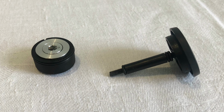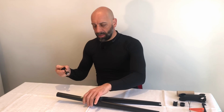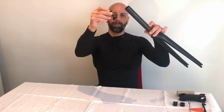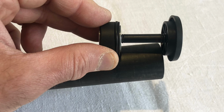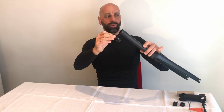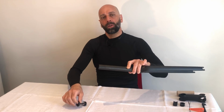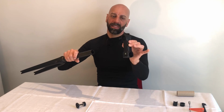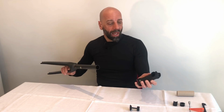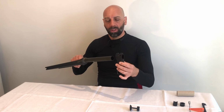So this is the usual setup. This is your top cap. This plug is usually around 3 centimeters inside the fork, and when you position the stem with loose bolts, you will be able to pull up the fork to compress the bearings, and then you will tighten the stem clamp. Very, very simple. I've been riding the normal stem and bar combination.